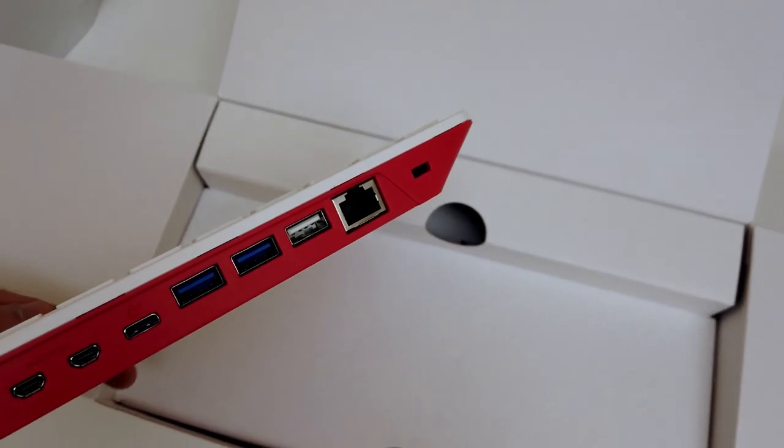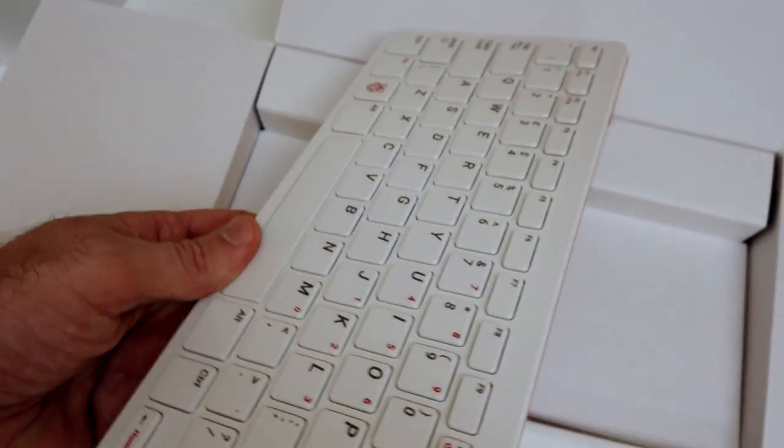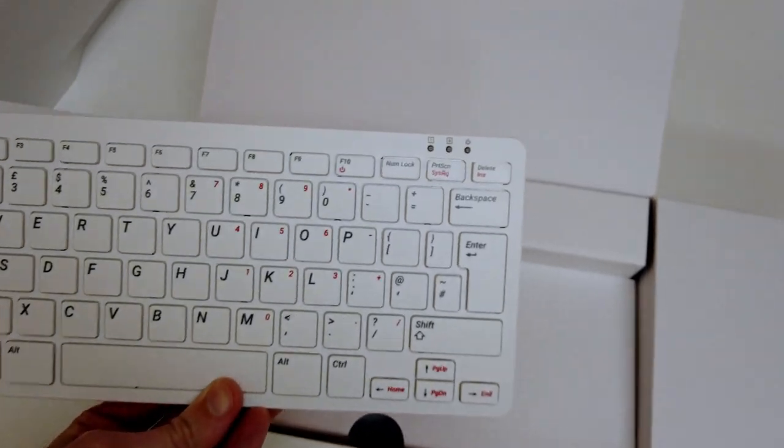You've still got the 40-pin GPIO, although you'd probably need an extension cable to get the most out of that. There's a microSD slot on the back, and it comes with a 16-gigabyte SanDisk Edge A1 card — not the fastest card in the world, but I'll be changing that anyway. It's still got the same two tiny HDMI ports. I think they should have taken this opportunity to make at least one of them full-size. It will apparently drive two displays and run at 4K, but the included cable only runs it at 30Hz — you'd need a different cable for 60Hz.